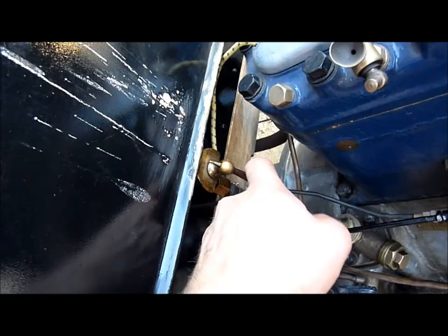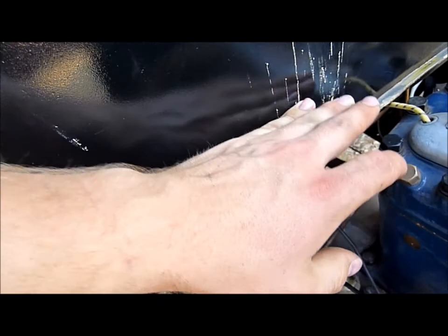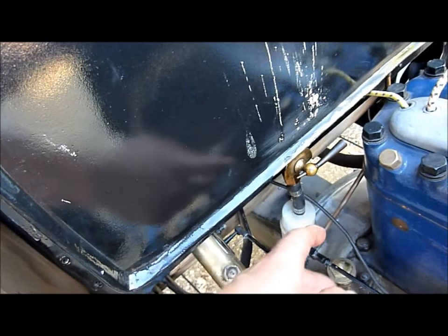I'm just going to turn the petrol off. That's on reserve, that's fully on, and that's off. What they have is a little pipe that sticks up inside the petrol tank. So when you've got it on normal, once it gets below the pipe it'll run out, and then you know you can just put it on reserve. So then you know you've only got a little bit left before you can get to a petrol station and fill up. Which is quite handy, because it doesn't have a gauge - that sort of acts as a petrol gauge. When you run out on full, you know you've got maybe five or six litres left to get you to the nearest petrol station, or you can have someone alongside with a jerrycan.